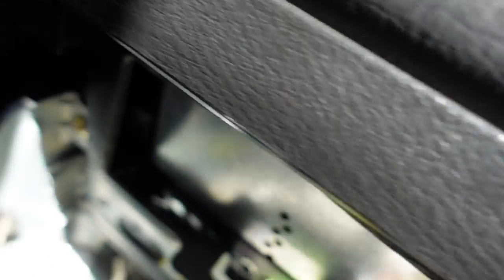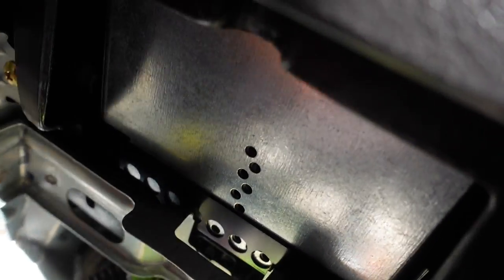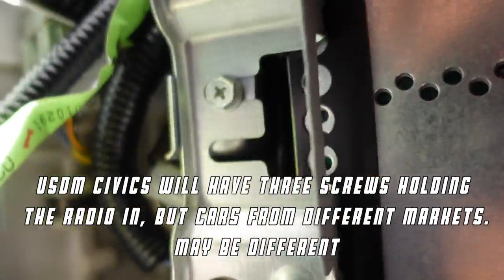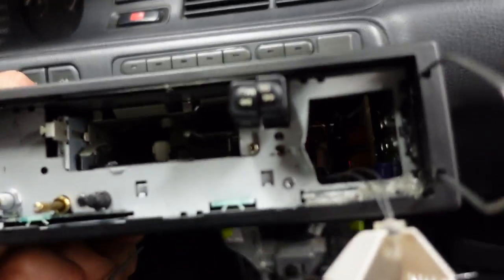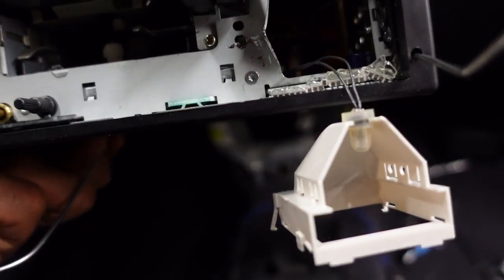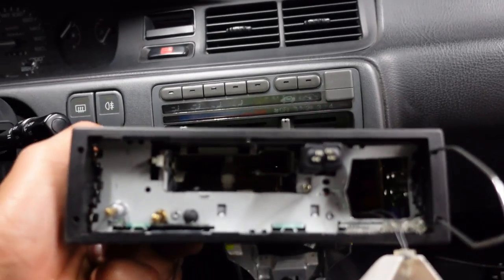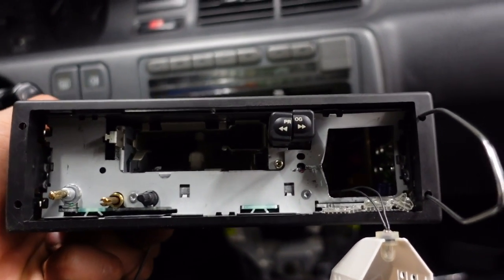Being the fact that my hardware is still all OEM stuff, I'm really trying to keep it all together and not lose it. If we look underneath here, there are two Phillips screws — one right there, one right there. You also got to look out for the cigarette lighter harness, and then you can go ahead and pull this whole trim piece out. Now that we have that off, we have access to go ahead and get our radio out.